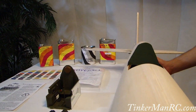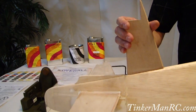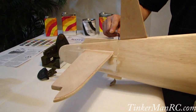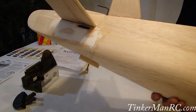Now we're going to go ahead and move back to the tail and show you what we've done with the tail that's unique. As you can see, we've got the vertical stabilizer installed, horizontal stabilizer installed, and your filler piece in here for your rudder. Here's your rudder control rod right here, and that's a one-piece item that hooks to your tailwheel that that servo I showed you earlier runs.